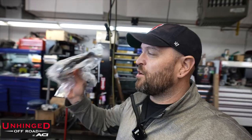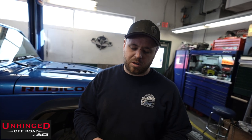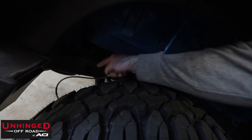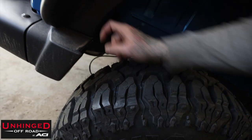These are the brake lines that come with this kit. The sway bar is currently in the way of the factory brake lines. These drill two holes up by the upper shock mount and inboard the hard line — these will go down to the caliper. Now they're inside of the frame rather than outside, so nothing's gonna hit. Safety first — you don't want to lose your brakes. Punch a hole, run those new lines through the frame to the inside, so less stuff is in the way.